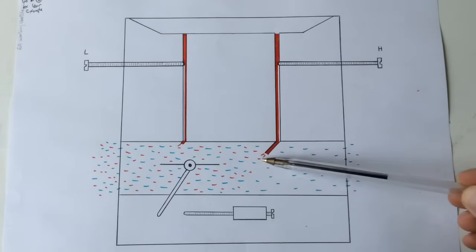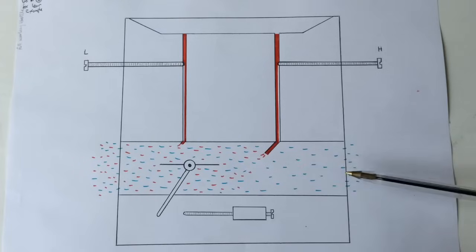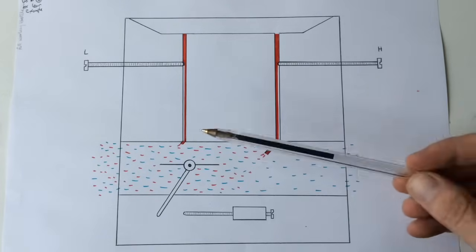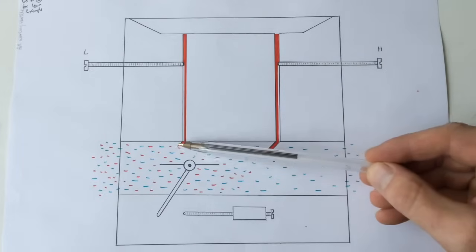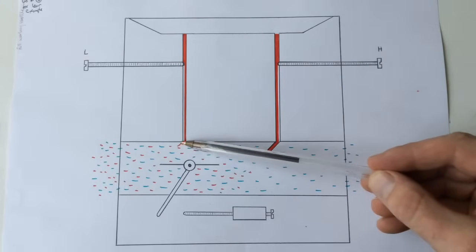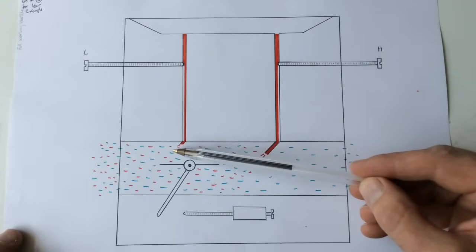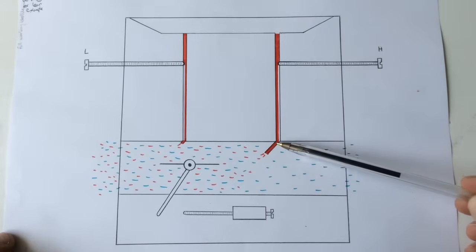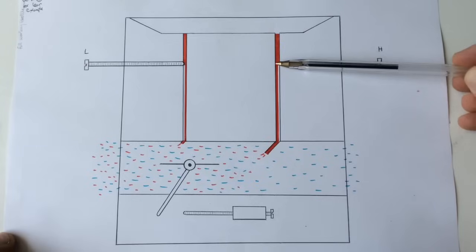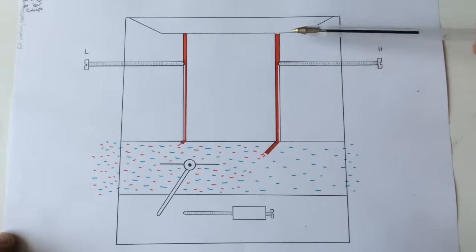One thing I wanted to mention: although you can see on the main jet that fuel is being drawn out at this point by the air rushing through, it also does so to a small degree here on the low screw - it gives a little amount even at full throttle.